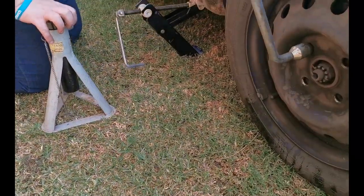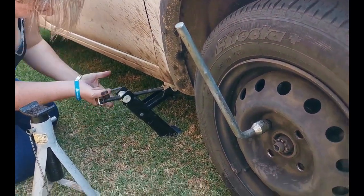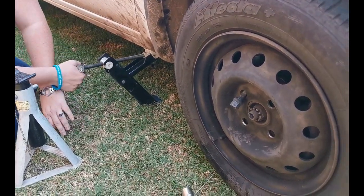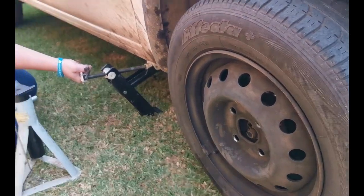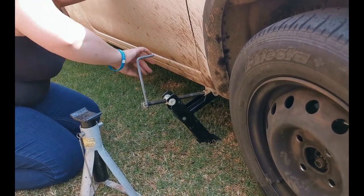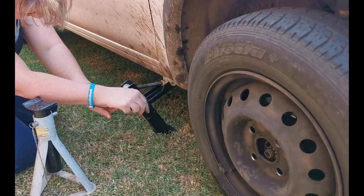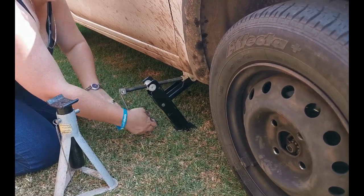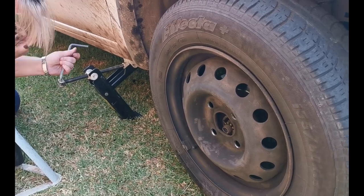Remember never to take out all the bolts while the car is standing on the wheel, because you have all this weight on your wheel, and if it shoots out, it's going to be nice and bad. See, that's why I said jack it up. Jack it up. Be glad you had the jack in place. So now you learn the lesson. Never take out all the bolts at once. Loosen them, but keep them in place. And then you jack up the car.